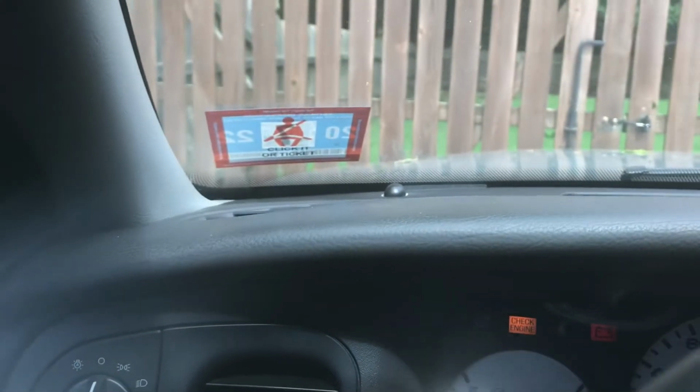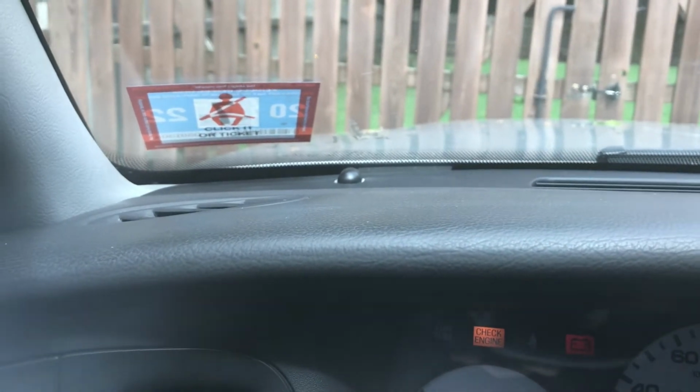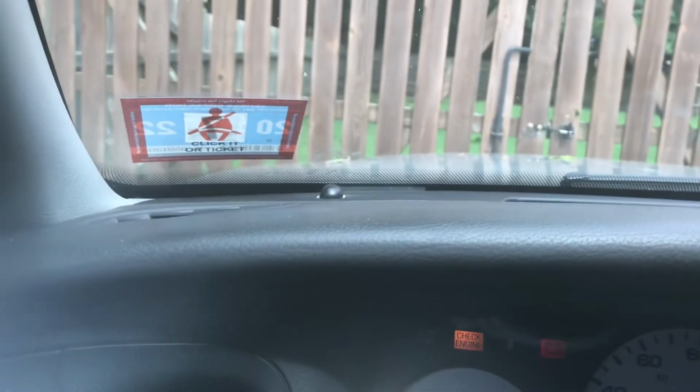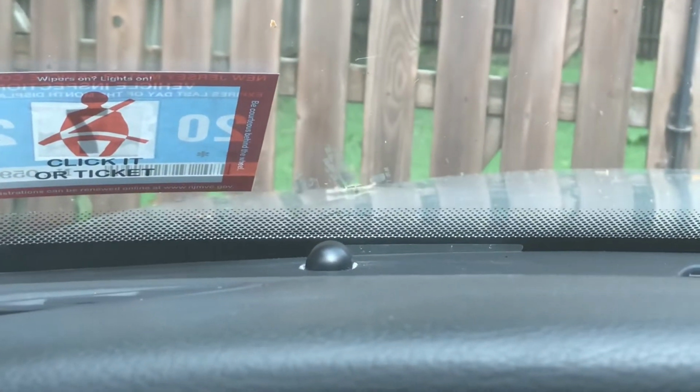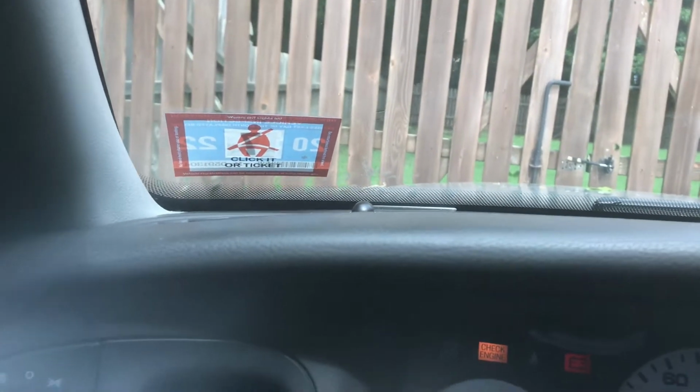So all Ford vehicles out of the factory from this era had a PATS system. This is the system that all of your keys and key fobs out of the factory work with. You can tell by having that weird red LED thing at the top of your dashboard that flashes every 2 seconds when the car is off.